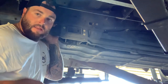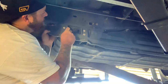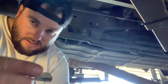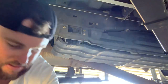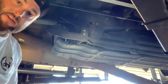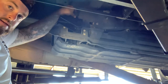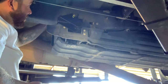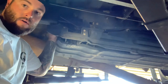You've got these bolts, washers and nuts which will replace the originals. I'll get a screwdriver and slide them off the chassis. So I've got the small 13 millimeter bolts just nipped up - they're not tight at the moment. Then you've got these really large bolts that go in the top up here. I've already got one in there. I'm just going to nip that one up and then make sure it's all square before we torque it down and mark the other holes we've got to drill.